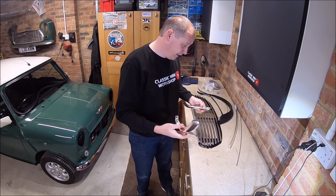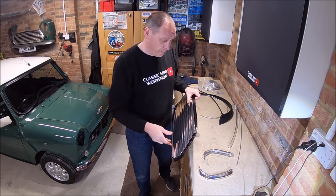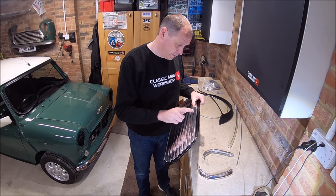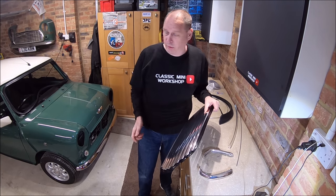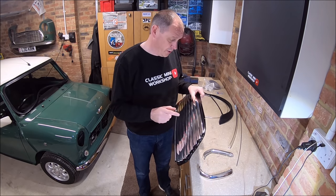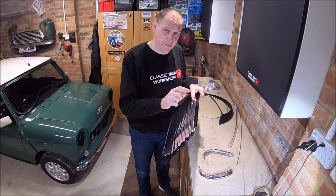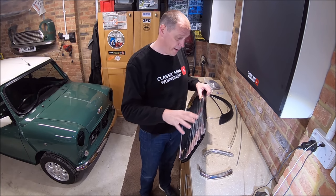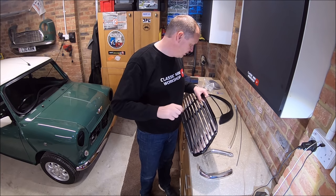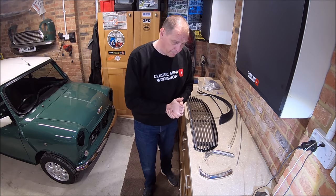I'm going to rivet these end pieces onto the grille, and one of the viewer subscribers mentioned how I'm going to fix the grille. For the moment, I'm just going to put it in with stainless steel self-tappers, but I need to order a rivnut gun to fit the mirror on the nearside where I put the door skin on. When I do that, I might see if I can get small enough rivnuts to put bolts in the front grille. So rivnut the front panel and put bolts in, it's a little bit more secure. And the self-tappers, as you well know with Minis, the holes just get larger and larger and the screws become loose.